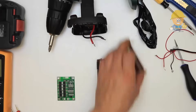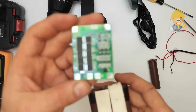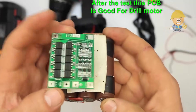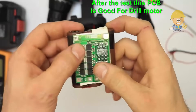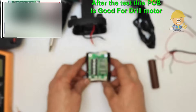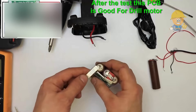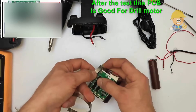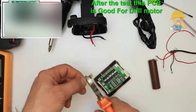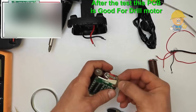In the new module I will use only three cells with a final voltage of 12.6 volts. We will follow the same steps as the first module. When wiring: negative at 0 volts, 4.2 volts, 8.4 volts, 12.6 volts positive — please do it strictly according to the wiring diagram. The products I use can be found on my blog — see link in the description of this video.